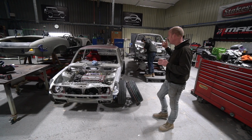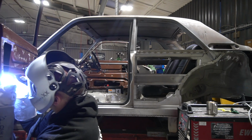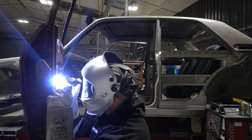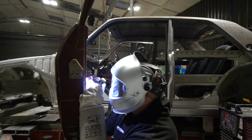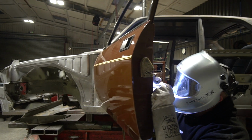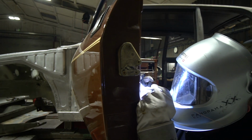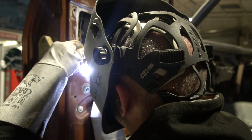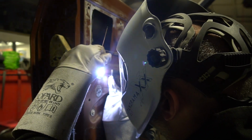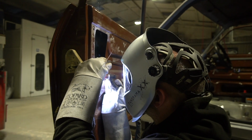Bobby has also been working on the doors for car number 2, the brown car. Yes, we haven't got the doors for this car here at the moment. They're at KS Composites at the moment. He's been working on the doors for the brown car, the second car, fitting the central locking actuators into the doors on that, making the provisions for those. And he's also just finished off doing the provision for the wiring conduits that go from the A-pillars into the actual doors themselves, so we've got somewhere to run the wiring through.